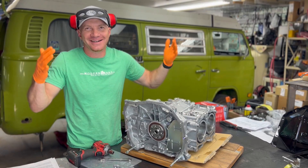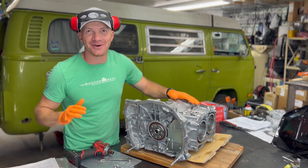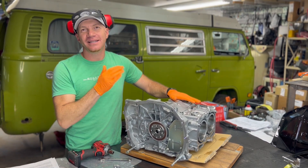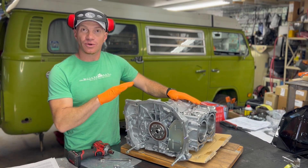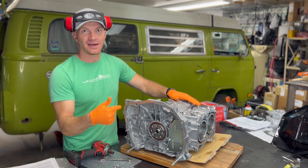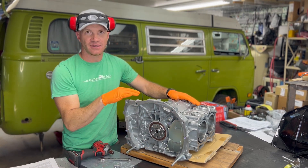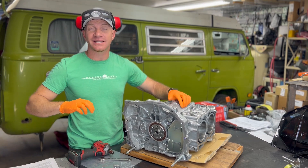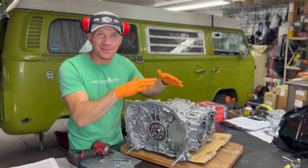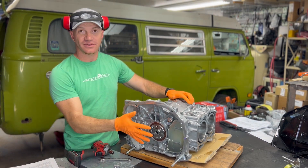That's the unboxing video — I hope you enjoyed it. Here we are with our short block. Hope you enjoyed the slow-mo shots. This thing is beautiful, ready to be built up. Next part in the series — we don't normally go in this order, but we need to put this on our engine stand using our VW holder adapter. We'll put the adapter plate on the back before we start putting heads and everything on. It's been motor building week — we've got five motors taking up all our engine stands, so we're using the bench stand.